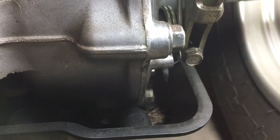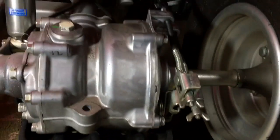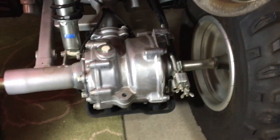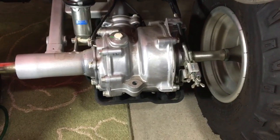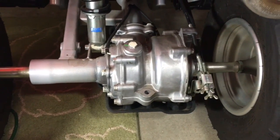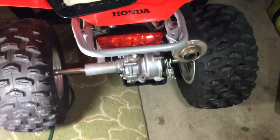That's how you relieve any water that might be in that casing — you can let it dry out, inspect the brakes, and get your brakes working again. I hope this tip helps you out if you've lost your brakes due to going through a pond or a river or something. Thanks for watching the video, hope this has helped you out.